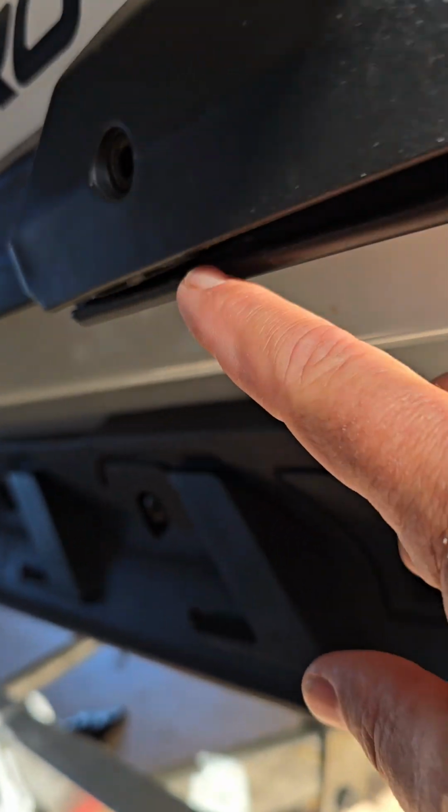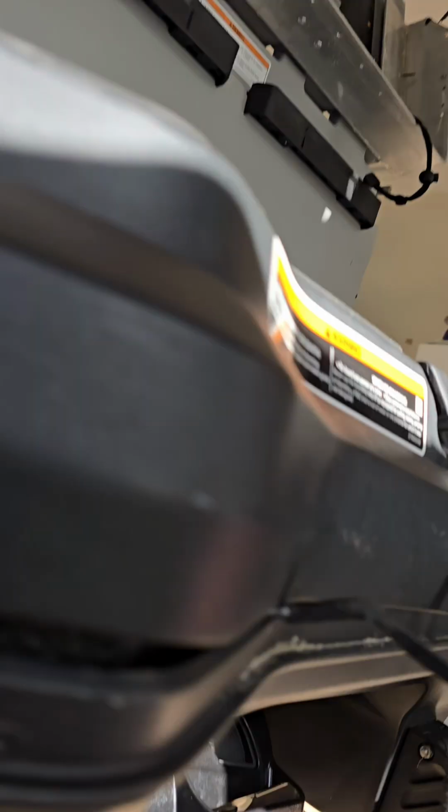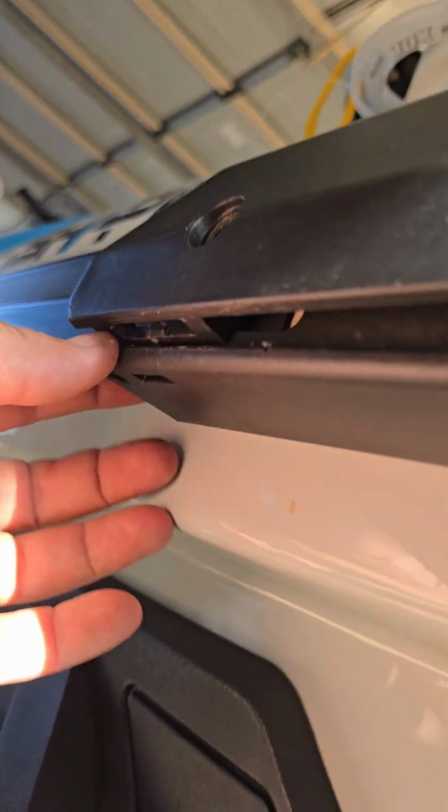Now there's a little clip here, guys, so you'll undo these screws and wonder why it's so tight. You just undo, like you can see I've undone the screws out of the back here, all the way until I got to the far side up there. Just put the screws on top so you can see where I've taken them out, and then I just put in a little wedge like this and popped it, and it came out without any damage. And the hardest bit to get out was this bit here.